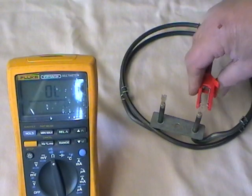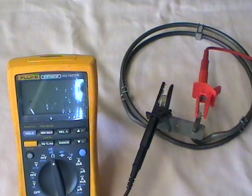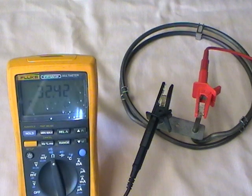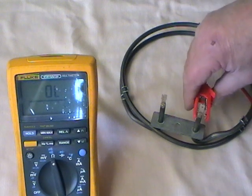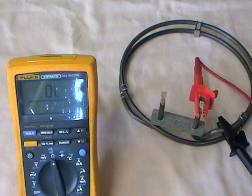One more time — this element is only 1600 watts, slightly different to the others which were 2000 plus, and you can see the resistance reading this time is 32.4, reflecting that there's a greater resistance which reduces the power used by the element. Test this one to earth as well — crocodile lead on the electrical terminal, the other on the earth on the chassis of the element, and there's a good reading.